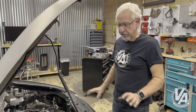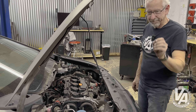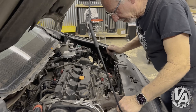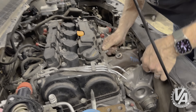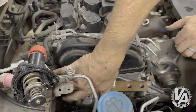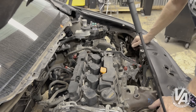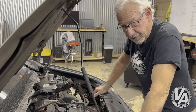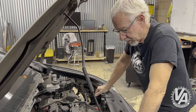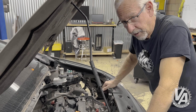So the K20C has really good ground clearance. The engine is no wider than — well, maybe that much wider than the L15. There's barely enough room for the turbo, but the turbo goes on. Pretty close clearance; there's a solenoid here that might need something done with that little corner, but all in all I think this might actually fit slightly better than the J. Good ground clearance — interesting. Let's take it out and talk about all three engines.